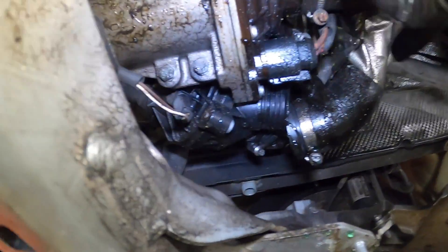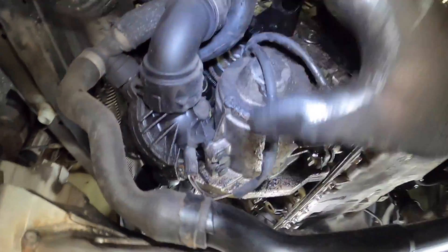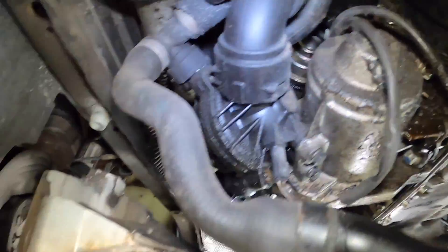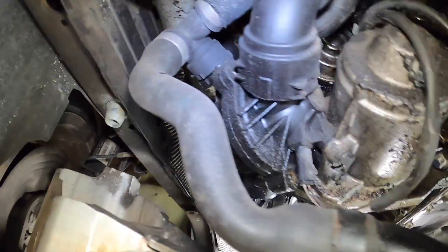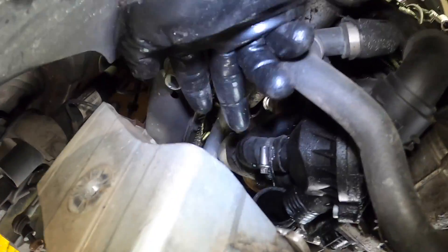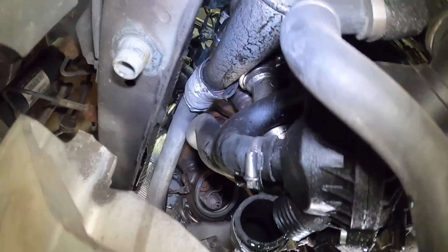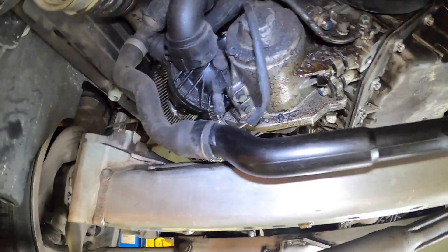You have to remove the electrical connectors and the ground — very important that you remove all those items before dropping the pump. All these things need to be removed: take out this, take out this, take out that guy right there, that U-shaped tube right there. And then obviously the hardware and everything should basically just drop down.